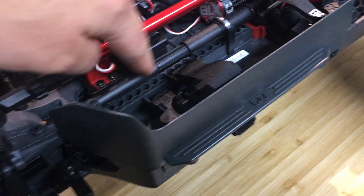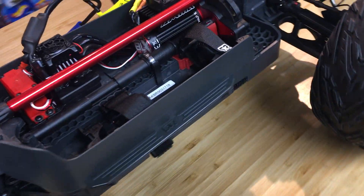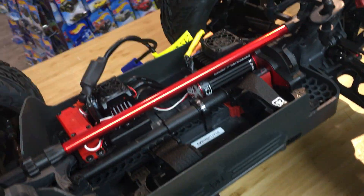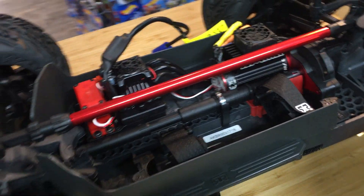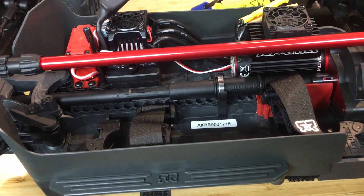Let's talk more about the truck. It has this telescoping center drive shaft. I think this is actually fairly goofy — it's got a center bearing in there. I don't really think that's a great design. I like what Traxxas does, or even what Redcat does with some of their shafts — keep it two-piece. It works fine. I'd like to see an aluminum shaft in there. Turnbuckles — we're returning back to a normal size of turnbuckle, and they're very, very tough, which is great.